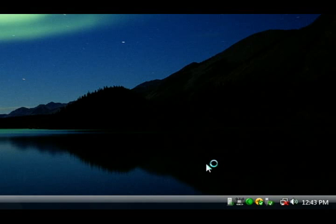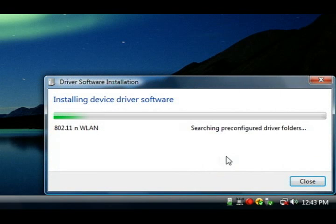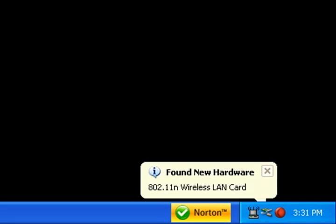On the computer's monitor, in Windows Vista, a prompt shows up next to the clock saying "Installing Device Driver Software." If we click it, we see it searching for a driver for the device that is already available on the computer. It finds one and says it's ready for use. In Windows XP, this process is essentially the same — the wording is just a little different.